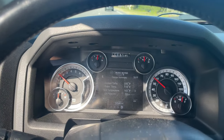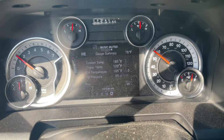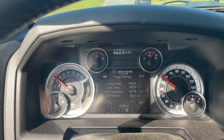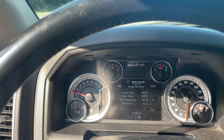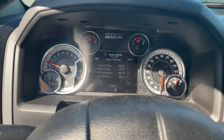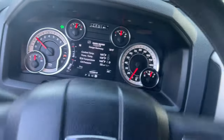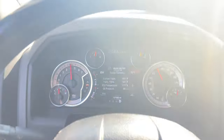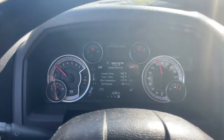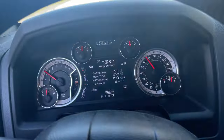You can see we're at 185 degrees. We're at 185, so I'm going to make a little U-turn up here, go back home to the driveway, put the funnel back on it, and burp it one more time. This heater is definitely hot. There's a lot of traffic here, but the stop-and-go would actually be good to help burp it. I'm trying to be a little careful — I don't want a whole bunch of pressure built up on the system. This little short ride is going to have some pressure on it. I'll turn the video back on when I pull up in the driveway.